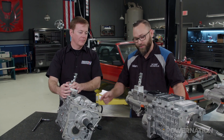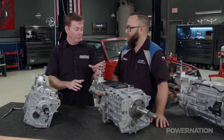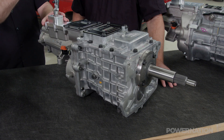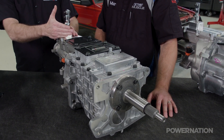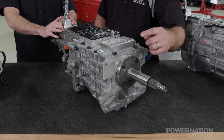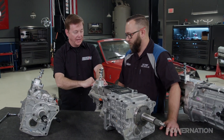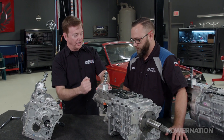If I go above that, I need to go to something like this. So the TKO was designed to be a replacement for the T5. It's about the same length, has the same shifter position as the Mustang T5, but it's a 600 foot-pound rated box. I noticed the input shaft's different — more splines here. Yes, so you have a larger diameter plus a 26-spline, so that gives you more holding power there. In the back end, same thing — we've gone up to a 31-spline output on the back for the TKO.